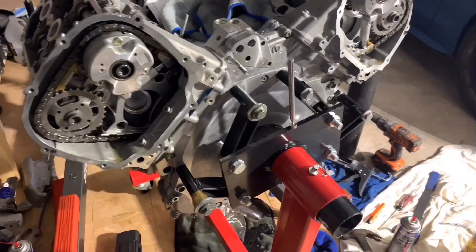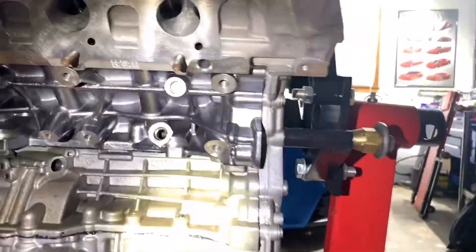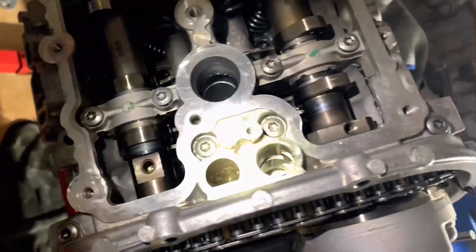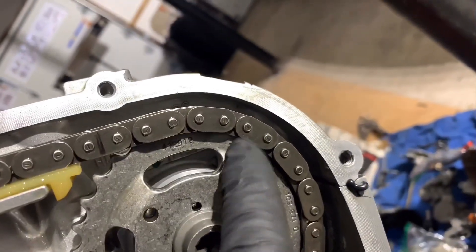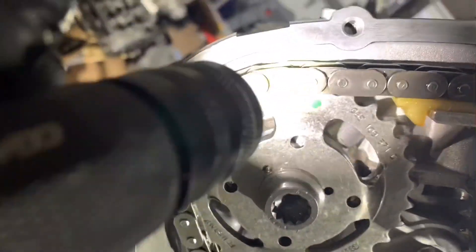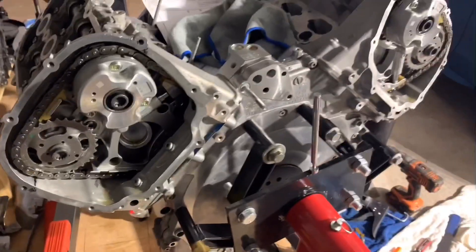I spun the engine five full cycles and the pin is right in place. The pin is right there in the center, all the cams look good. Checking the cam threads/caps — they should be flat. Timing marks: this lines up with this one, that one lines up with that one — it's right at the edge but it should be fine, timing chain is tight. Same thing on this side: right in the middle, perfect. Timing chain is all tight and good — all done.